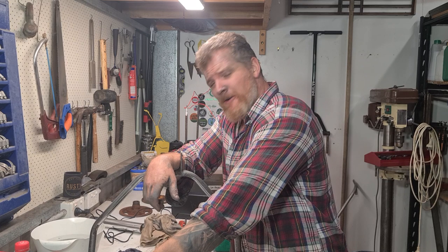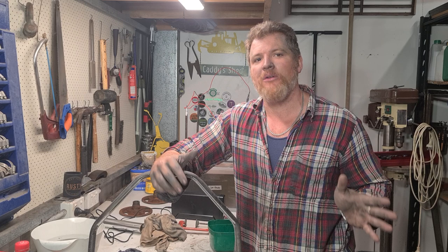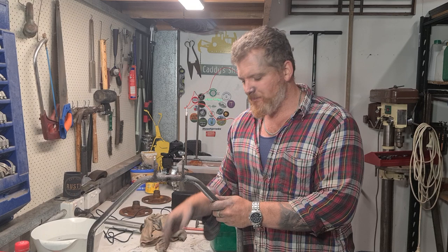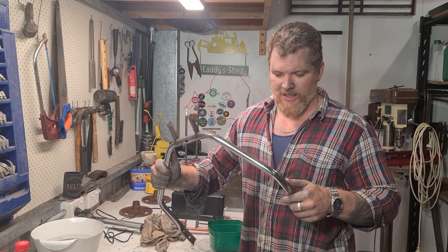One cigar and three beers later, we're done. Comparing the two — soapy water and alfoil versus Coke and alfoil — Coke and alfoil just destroyed it, man. Absolutely did a cracking job. I'm not sure whether that's because I allowed it to soak into the oxidization with the rag. I just soaked the rag in Coke and wrapped it around the handlebar — that may have played a part. But the Coke and alfoil did a ripping job. Having said that, if you're just dealing with light corrosion you might get away with it, but this is too heavily corroded to make a difference.